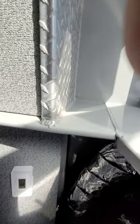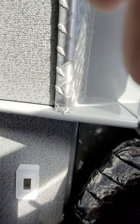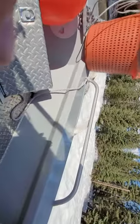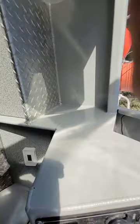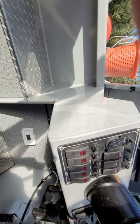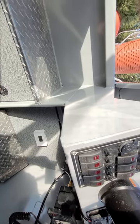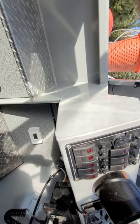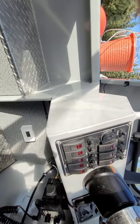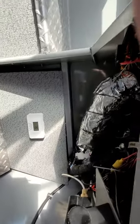The fan is blowing now and it's getting ready to light off. You'll know when it lights off because the exhaust gets a little bit louder. The first time I started this up, it took probably about four start-and-stop cycles where I had to completely remove power from the panel to purge all the air out of it. Then I let it run for a solid hour or so to get all of the packing oil out of it. It smoked quite a bit - I just opened everything up and let it smoke. Then it blew it all off and now it runs nice and clean.